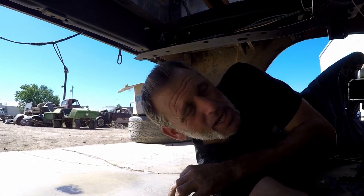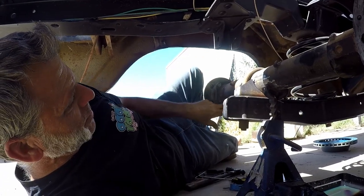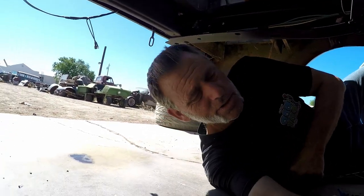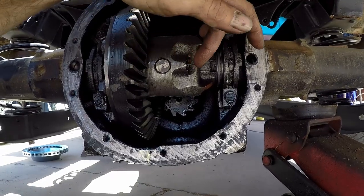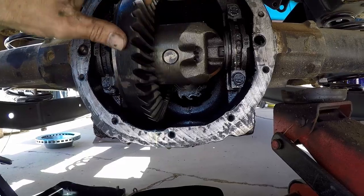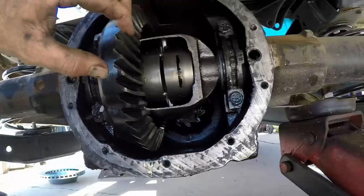So, in order to get the rear backing plates off, obviously you have to undo the four bolts, but the axle itself has to come out. And being a Chevy, it's a normal C-clip rear end, excepting the fact that it's got the posi in it. So I want to show you what we did. I've already done all of it, but anyway, that's a rewind. Here's your typical Chevy. Center pin bolt, loosen that, your pin comes out, zoop. Whoa, what is that? That is your posi unit there.